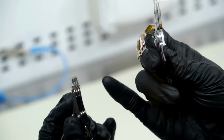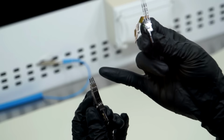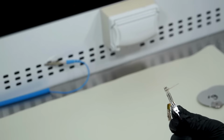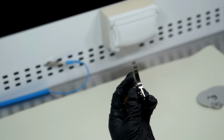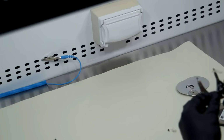That is cool. Yeah. So when these sliders touch together, because it is magnetic and because of the tension of them, it'll cause them to stick together. And if you try to pull it apart, you'll rip the sliders off of the heads and ruin the heads that way. So we use a head comb, this little white tool, to separate the sliders and the heads and remove it from the ramp. What happens if you don't use the head comb? Can you ever get them to not touch again? It's very tricky. There's a high risk that you damage the heads. So what's the head comb made of? Scotch tape? Styrofoam? It depends. I think these ones are made of some special CNC'd plastic of some sort.